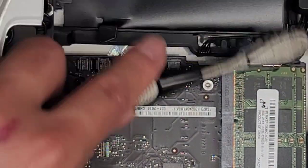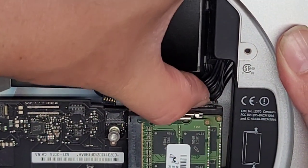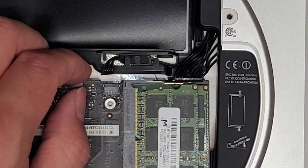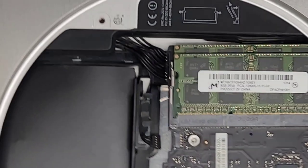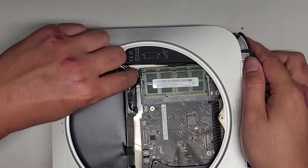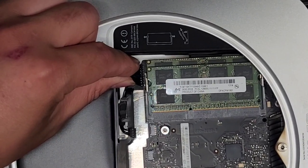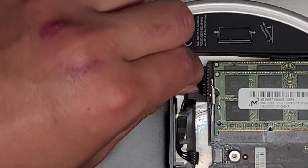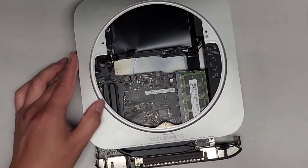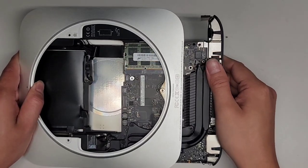There's all this smoke dust powder on it. Here you can see the power supply connector — we are going to have to remove that. I use my fingernail to do that, but you can also use a tool to pull it out. Now that we got that, we can go ahead and pull this forward more. You can grab that. You can kind of grab these cables and wiggle it side to side — just wiggle it like this and there you go. Now we've got that and we can go ahead and slide this out — just slowly, carefully wiggle it out.